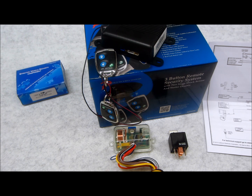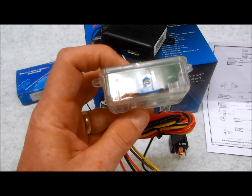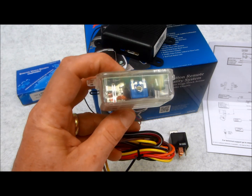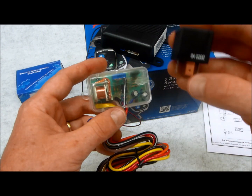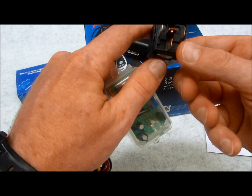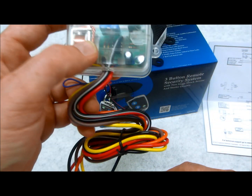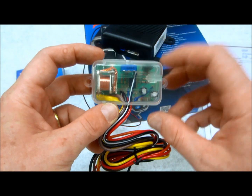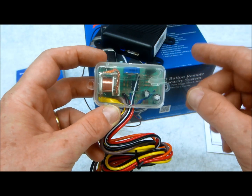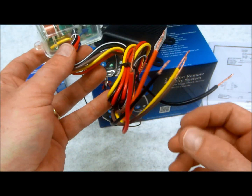To get that diesel fired up prior to cranking it over, you need that extended signal. The solution is this little device called the 528T. We sell these on our site for around 15 dollars. What this does is essentially take a relay's job — it's a single pole double throw, five-pin, 30-amp standard relay — but the 528T is 15 amps, which in most cases is more than sufficient. You can also use it to drive an external relay if needed.